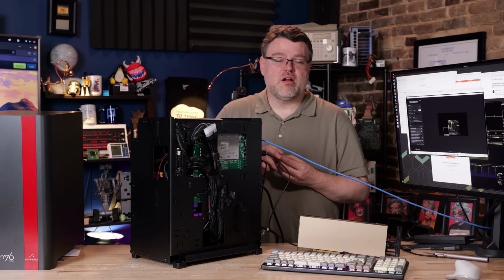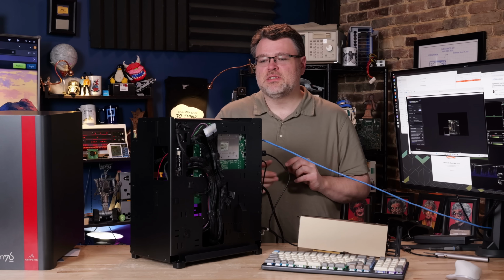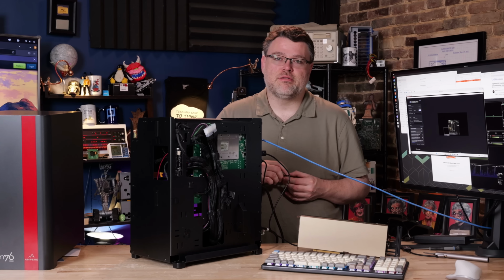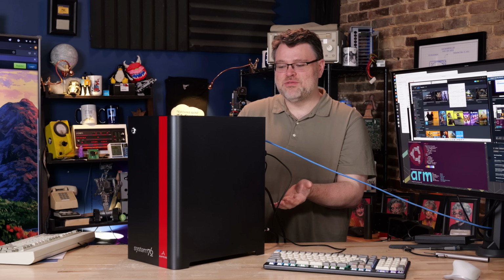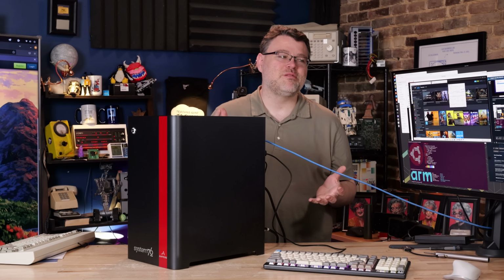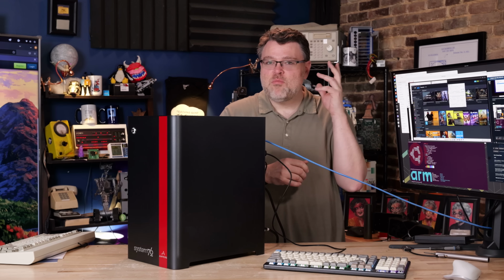Now for Windows 11 on bare metal, you will need a hardware TPM module to make Windows 11 happy. Fortunately, System76 can ship you one, or you can pick up one on Newegg or from the internet for 20, 30 bucks. It goes on a header on the motherboard and that's pretty much it. And how insane is it? It's like System76 running Windows on this hardware. But again, if you're a developer and you're doing multi-platform ARM development, this is great. This is fantastic.